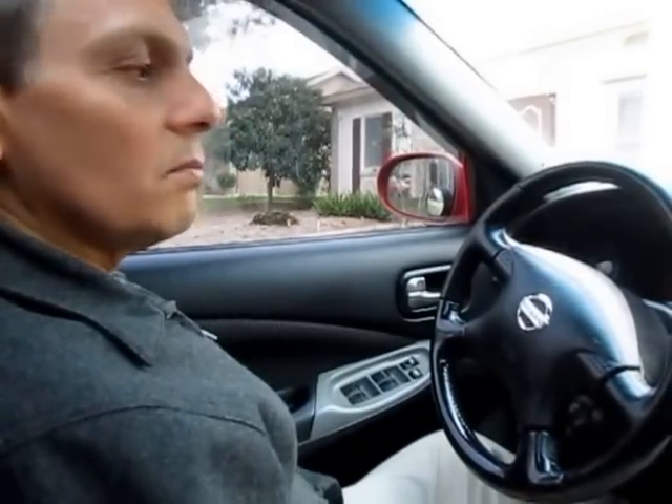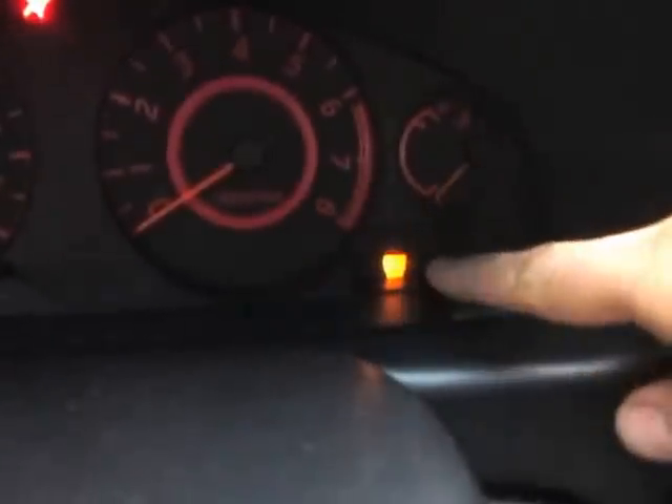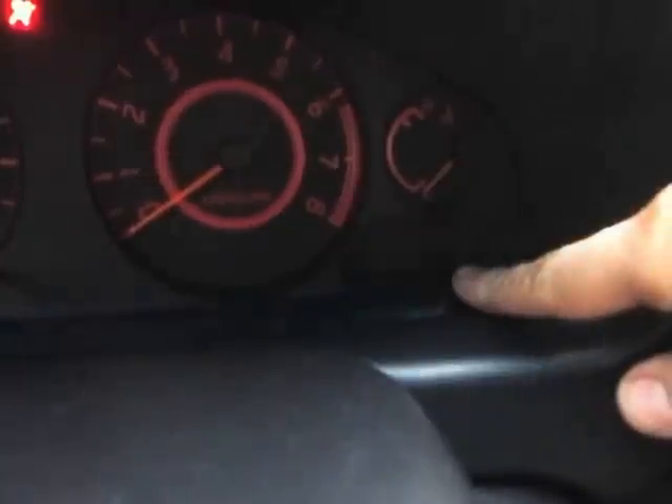Let's take a look at the inside of the car. The check engine light was replaced with a signal from the controller, so this light will now show any errors from the controller. It has a programmable gauge showing vacuum level for the brakes, and if vacuum drops you'll get an alarm. For example, when I push the brake several times and it gets to 10 — which is my programmable default — it starts sounding the alarm, and when it goes back above that it gets quiet.